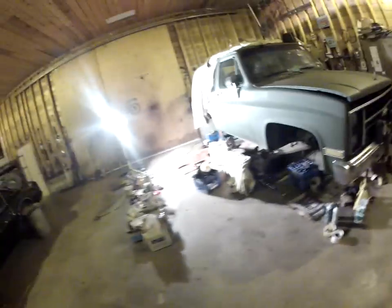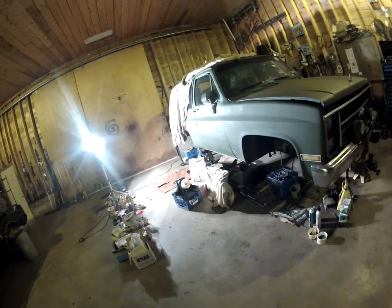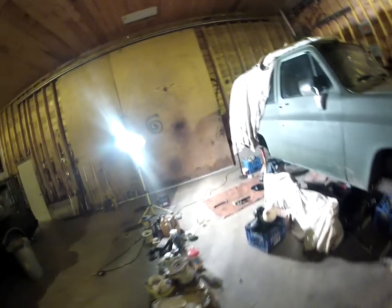I got my axles all painted and I'll be ready to go from there. My pinion angle is going to be steep — as you can kind of tell, there's the nose of my rear end and there's the transmission, and the driveshaft is going to be quite angled. So I'm going to do a transfer case drop of one inch to get my driveshaft more lined up so there won't be any banging and I won't be going through universal joints in about a week.